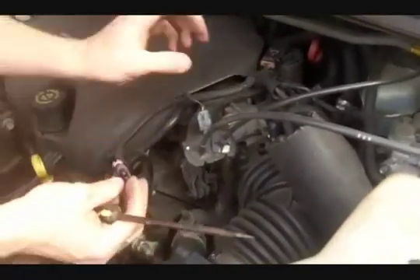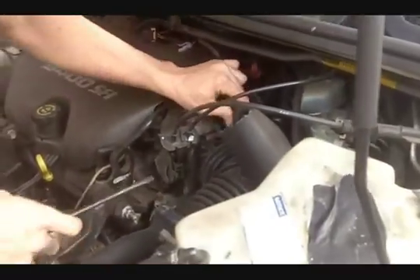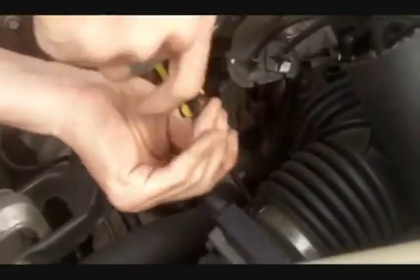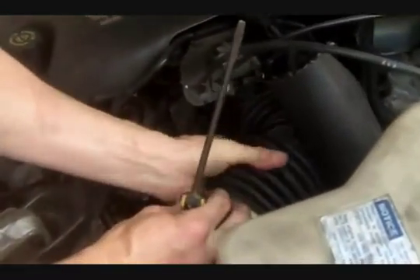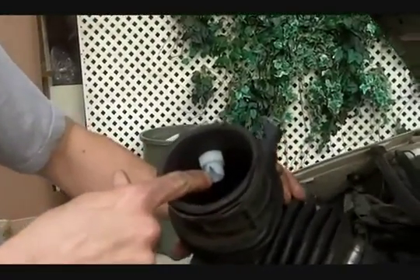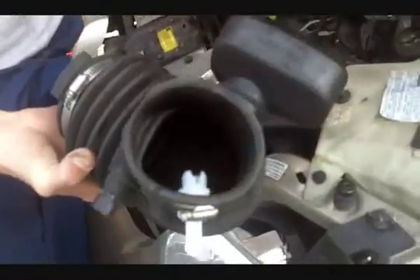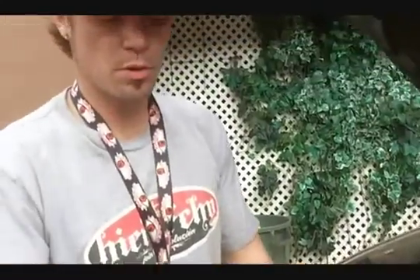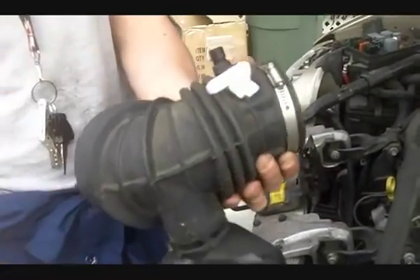Be careful when you're disconnecting things — you can either mark it or just make sure you know where all the stuff connects back up to. Here we go with the air intake. Right here I put a little sliver in the inlet so that the gas has an easy place to flow. It actually makes it go in the direction of the throttle body of the engine. Then you put the locking nut on and that's it. Also you want to put some silicone around here to seal it, then install it on the car and put silicone on it to seal it up.